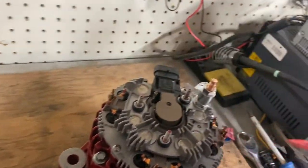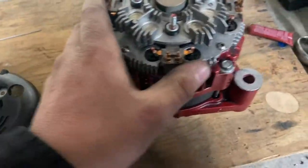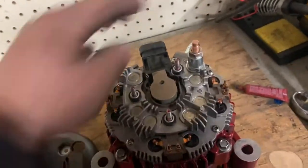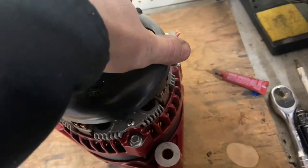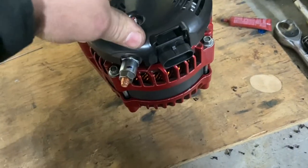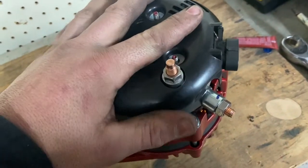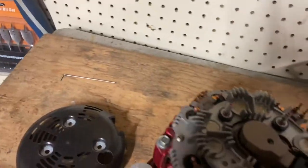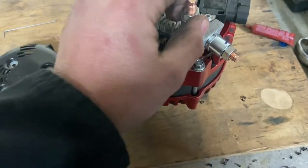I'm going to move this meter and get it out of the way. One of the other things I did while not recording was work on the SRE cover. I took one that was made for the side mount and used a grinder to cut the opening out to fit across that regulator. Then for the charging stud we added in another video — to make it a dual charging stud — I had to drill a hole out with one of these unibits. That gives clearance so we can get everything bubbled up, still cover it safely, and have access to both charging studs.